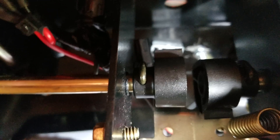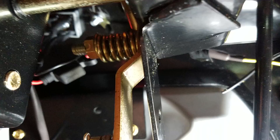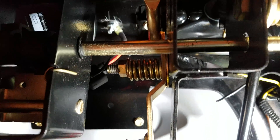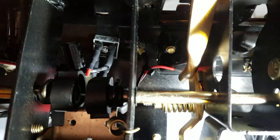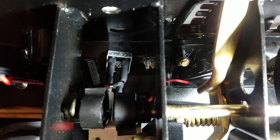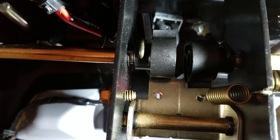I have my AC voltage running to the AC positive there. I placed a fuse in between — the fuse is right there. Basically, that yellow wire from my engine: I put an inline fuse with a 5-amp fuse and then connected that to my bridge rectifier.